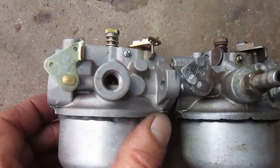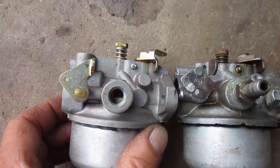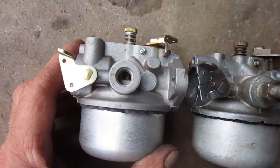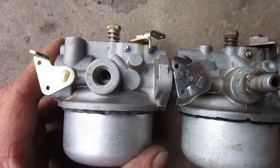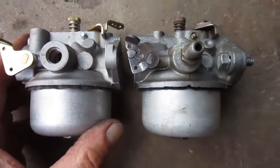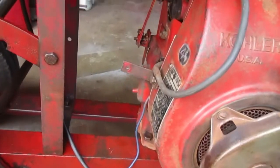The hole needs to be the proper distance from the shaft, and on the proper angle from the shaft. So if you're going to try that, don't make a piece with a hole and try to weld it in position. You need to make the piece oversized without a hole, weld it on, then drill the hole in the right place. The last step is to grind down the outside so it looks like it was the right size in the first place.